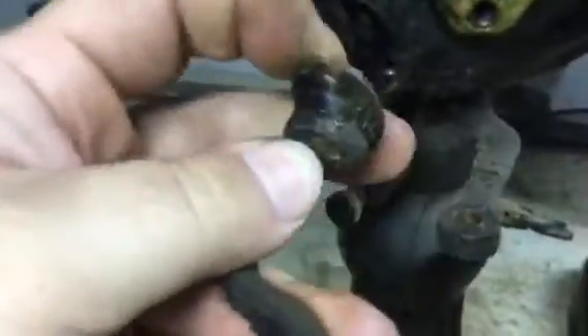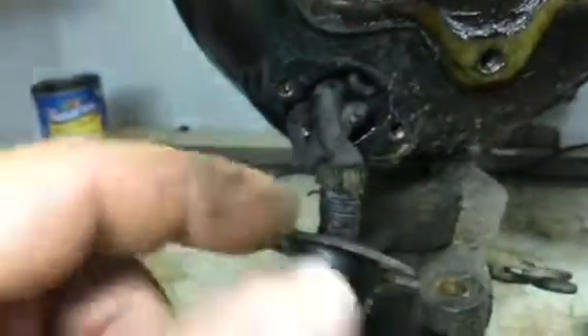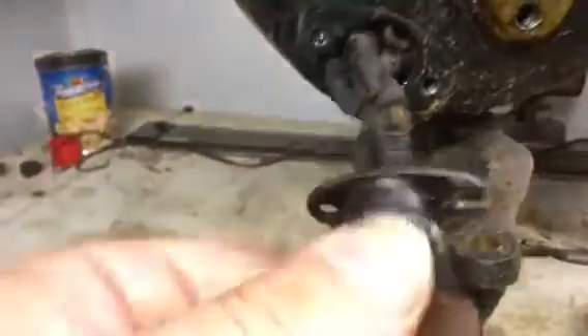You can see it's slotted and there's a lot of gunk on there. This is what Emerson described in their advertisements — you can pull this out and these are the tape connections where you could solder on a new head wire without taking the fan apart. I'll go ahead and cut that there. There's our old head wire — it was still good.